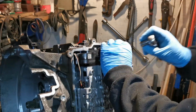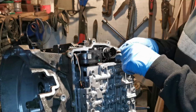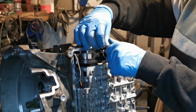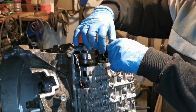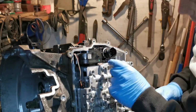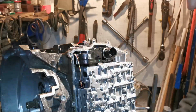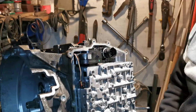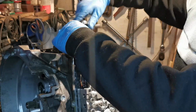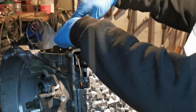You know, some of these little plastic bits, they're very delicate, fragile, especially from Ford, of course. I was taking your bumper apart, this grill thing on the front, it sort of fell apart a little bit. You need to watch out for this now. There, you need to remove that bolt there. What is it, 10mm? Yes. Because that little 10mm holds the little wheel intact.